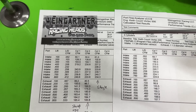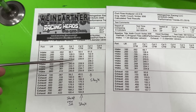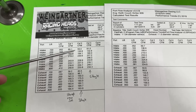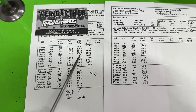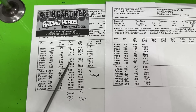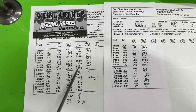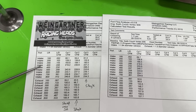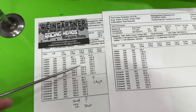With the three-angle valve job added, it went from 219 to 231 CFM — that is a large jump, and no grinding was done at all. Looking at the other lift points: same at .100, 2 CFM better at .200, almost 10 CFM better at .300, and about 10 CFM better at .400. It did lose at .500, going from 244 down to 229. It's better at .600, worse at .700 and .800 — but these heads aren't cut, so the most lift you're probably going to get is .450. So that's a win. That three-angle alone was worth it.